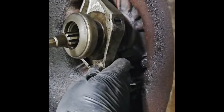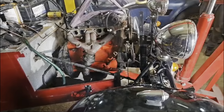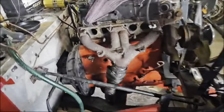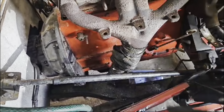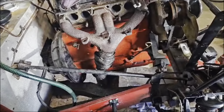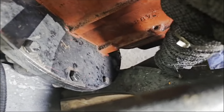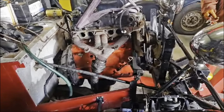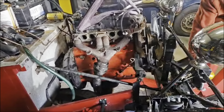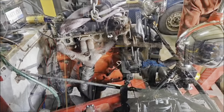Pull the assembly forward a little bit — we're going to lubricate behind here to make sure the shaft is very well lubricated before we attempt to reassemble. Everything's lined back into place, which was a bit of a challenge — a lot of shaking and jerking to get the shaft in correctly. Really really important that the shaft fits correctly otherwise the clutch won't work. Now we're going around putting all the bolts back on and dropping the engine hoist down to test if we've done it right. If so, the manifold and ancillaries can be screwed back on along with any rubber pipes that need replacing.